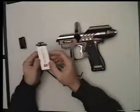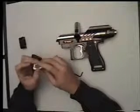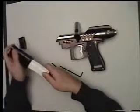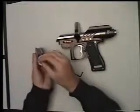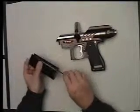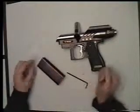This is the nickel metal hydride battery pack with the contacts on the top. This O-ring acts as a spacer in the bottom of the battery pack to push the contacts up against the top portion of the battery housing. So don't forget this when you put it back together. Simply slides in. Top on. Put the O-ring in. And your battery pack is back together.